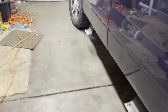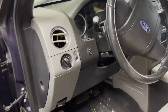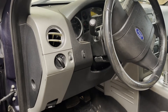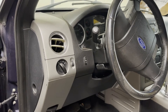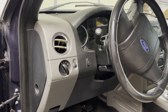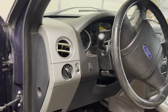This thing has the typical 5.4 cam problems. It's knocking pretty good and the oil pressure light is coming on after it warms up. I don't have a battery in it right now, but you can Google it and you'll find tons of them. I kind of hoped I could just tear into it a little bit and maybe see if I could get it going better, but I got pretty sidetracked on this frame issue.